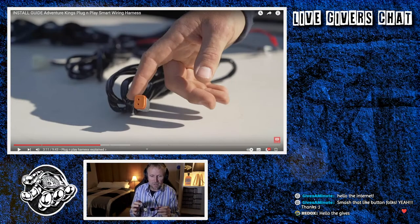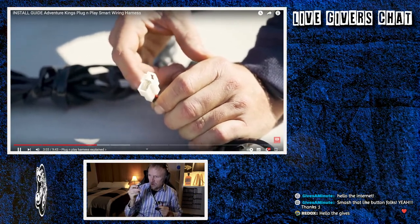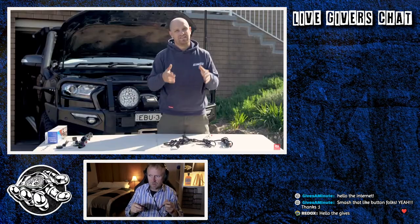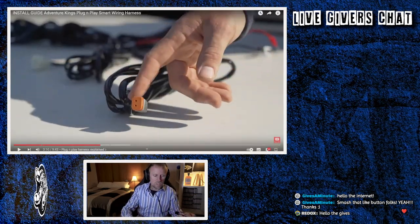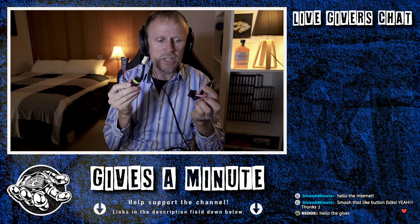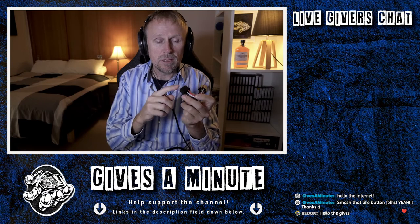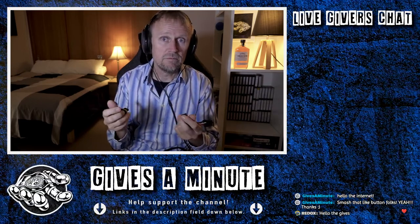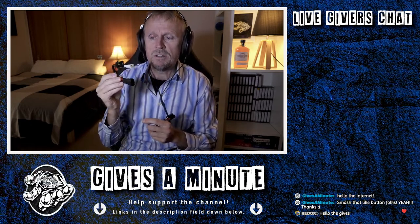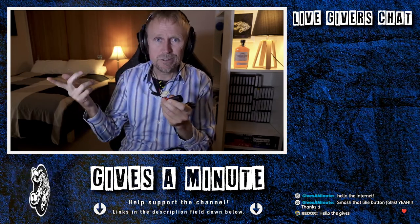So he's talking about either of these two, and he said the next length of cabling is this one here with the white T-shaped plug. It connects to one of those two supplied headlight piggyback adapters that plug into the back of your headlight. So what he didn't really indicate there is that these are two different pieces, an identical junction point, but with separate plug points for different headlight varieties. Now, what he doesn't explain and what I'm assuming happens here is this goes into your existing light and then piggybacks off to your new lights.